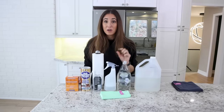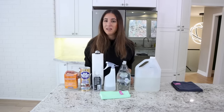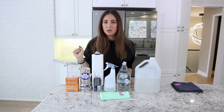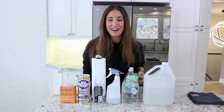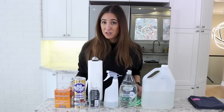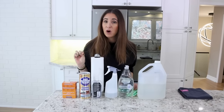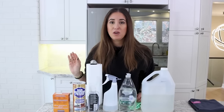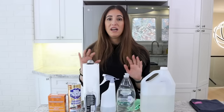If you have rust stains on your fridge — little spots where the chromium oxide layer has come off — there are two ways to deal with that. First, you can use a paste of baking soda and water, gently rubbing it on the spot with your finger in a small circular motion. Rinse, wipe clean with a flat weave microfiber cloth, then spray and wipe. For heavier rust stains, level up to a product like Barkeeper's Friend. The key is to always keep the product wet — make a paste with the powder version and work quickly, or use the liquid version.